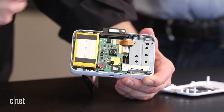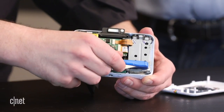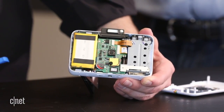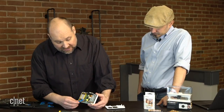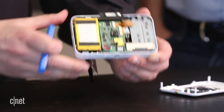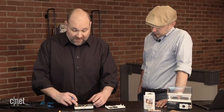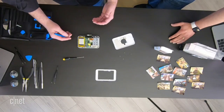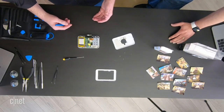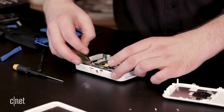Of course, we have the battery pack over here, we can see the actual camera sensor right there, and we can see the printer mechanism over here on the left side of the camera. We can see a few of the chips already on one of the circuit boards in here. One of the first things I always like to do with these devices is disconnect the battery. This is a fairly large battery — it has to store enough power to power the flash. The battery has to be kind of beefy, so we're going to remove this first — we can lift the battery right out like this.